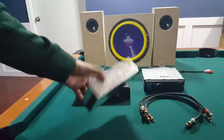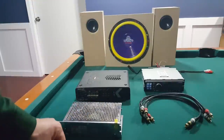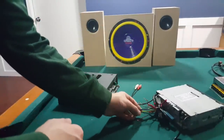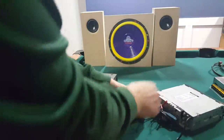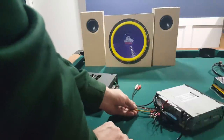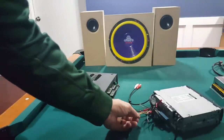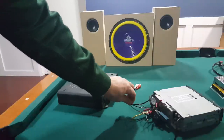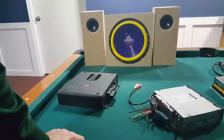Basically we're going to hook up all the power to the power supply first — the head unit and the amplifier. Turn your car amplifier around and look for the wires you need. I've gone ahead and crimped all the ones I don't need, but you need your yellow, red, and black wires. Red is the switched power, yellow is the battery lead, and black is your negative. We're going to connect those to a slightly larger wire that connects to your power supply.